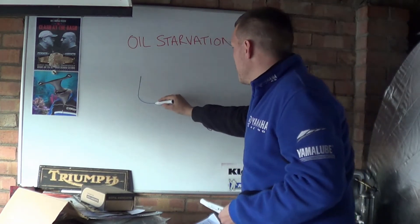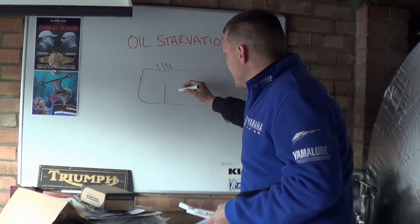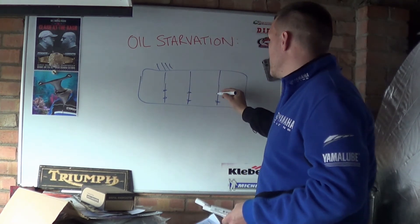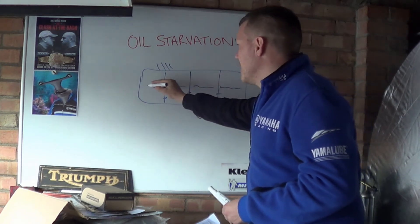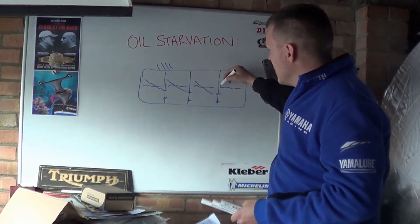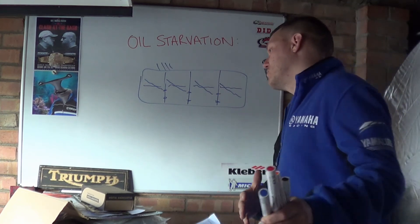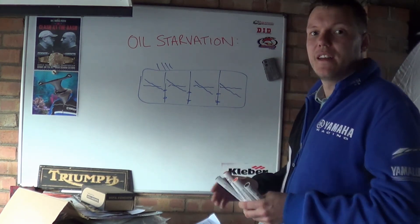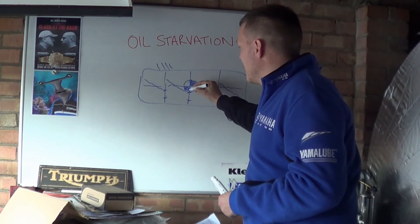You can see this with cars too. Cars have big fuel tanks with their pickups, return lines, and baffles. Baffles are sometimes full length with holes in them, and what they do is stop fuel sloshing around so the fuel stays in each cell. When you whip around a corner hard, the fuel level tips in each individual cell due to g-forces, but you're not starving the tank. It also stops fuel shifting side to side, keeping your weight distribution and center of mass roughly centered.